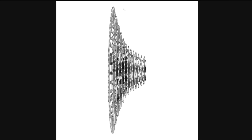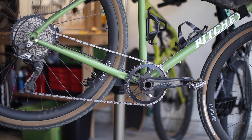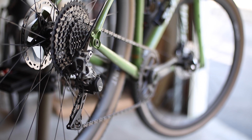If you look at the brand new Campagnolo Ekar 1x13 rear cassette, you can see this visually — the size of the cogs varies non-linearly, with the bigger jumps clearly occurring at the larger end of the cassette representing the lower climbing gears. By the time you get to the faster end, it almost looks like a standard road cassette with really fine incremental jumps. So the 1x system is really trying to do everything in its power to be an effective replacement for the tried-and-true 2x setup. Sure, you'll lose a little range and get slightly larger jumps between gears, but those larger jumps are strategically placed in the climbing gears, where presumably it matters less.